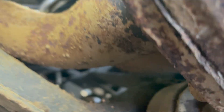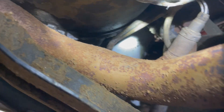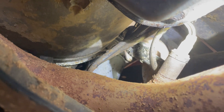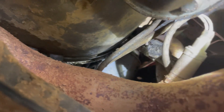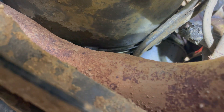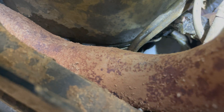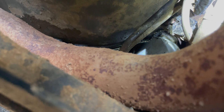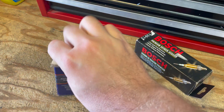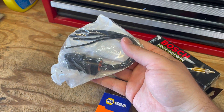It's a little hard to see it. There we go — you can kind of see it. You see where the wire comes up off of the O2 sensor and then it goes to its connection? You see how it's all melted right there? I think that's going to be a big part of our problem, or at least I'm hoping that's our problem right there. If nothing else, it is a problem.